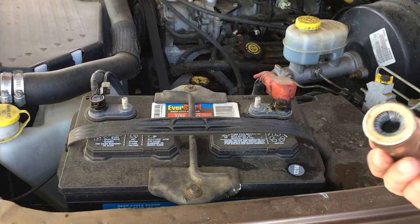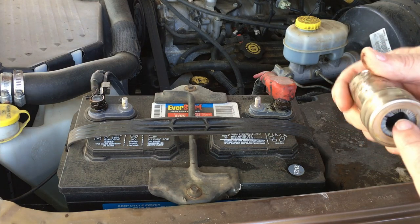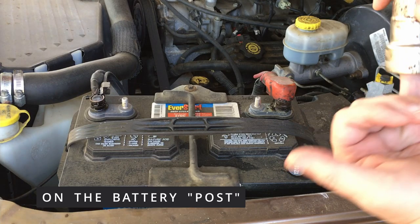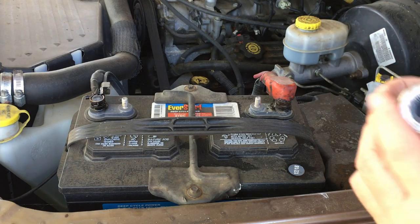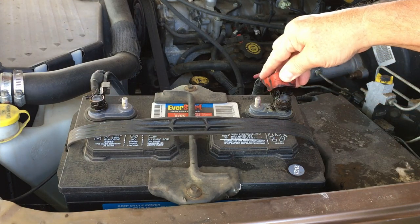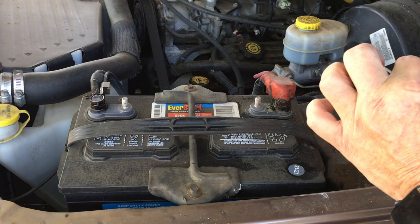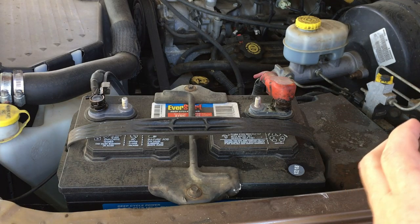So what you need to do is keep those battery terminals clean. This is a little tool I bought a long time ago — basically it's a wire brush inside. It goes down on your terminal and you turn it around. Your battery terminal goes up in there, you spin it, those wire brushes inside clean and polish it, making the lead terminals nice and silvery. Then this side comes apart and goes into the clamp on your battery to clean the clamp out. It's a two-stage little operation.